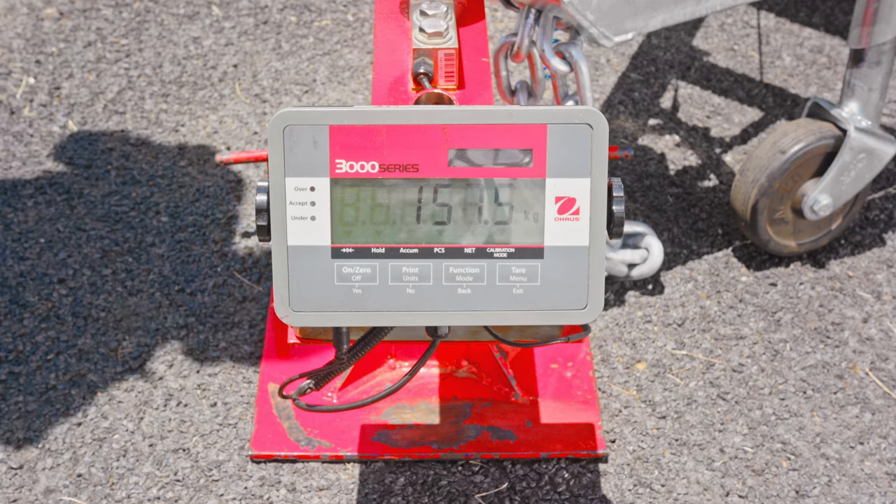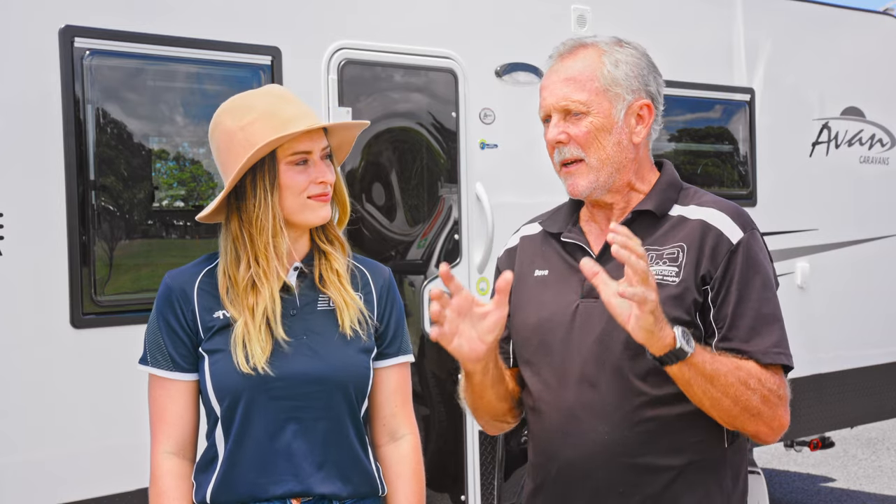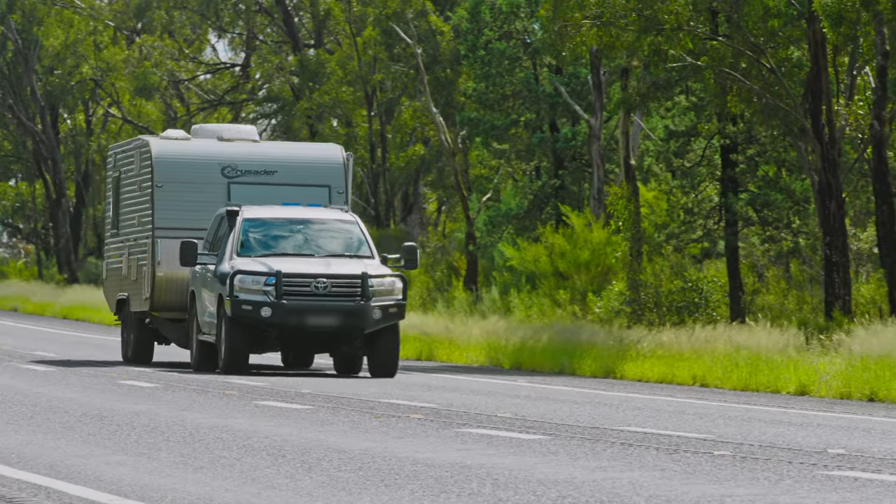So now that we've measured our tow ball mass, are we good to go? Holly, we're good to go. The main thing with the tow ball mass is we need to maintain about 10% of the overall loaded weight of the caravan, which is the aggregate trailer mass or ATM. We need to maintain about 10% of that weight on the tow ball to make sure that the caravan travels safely.